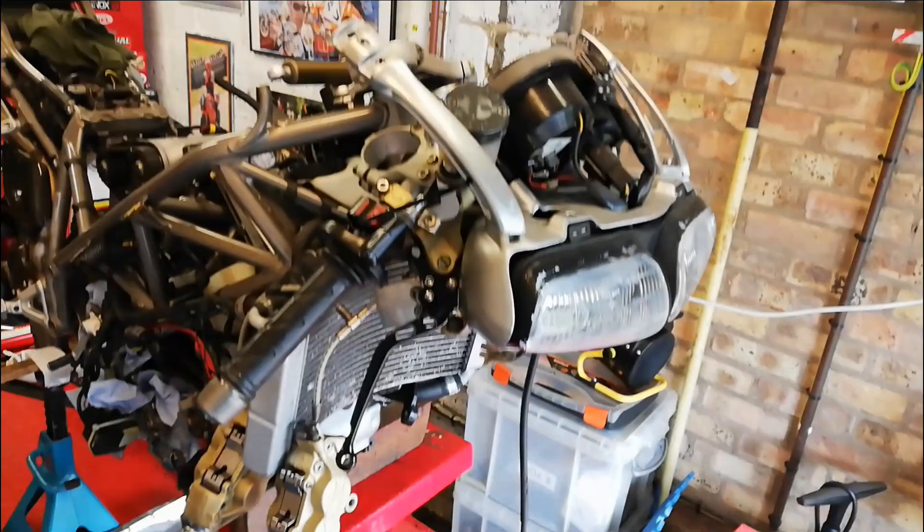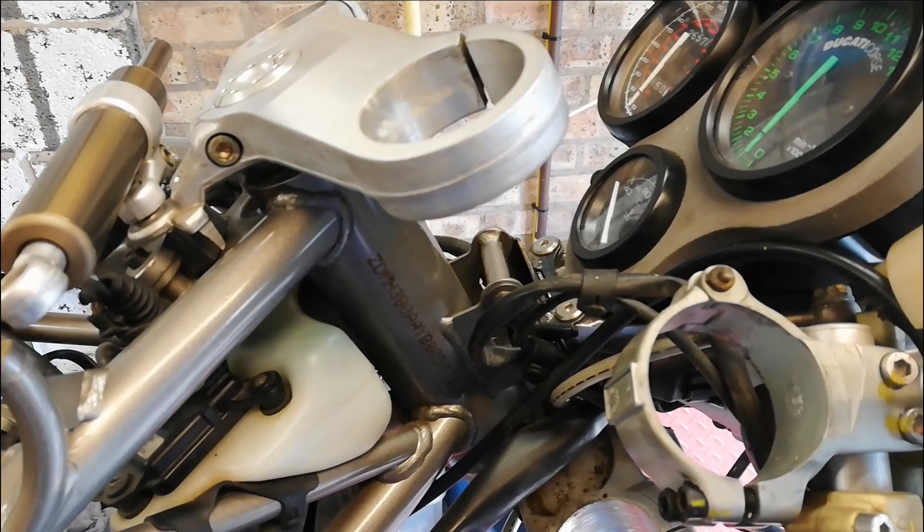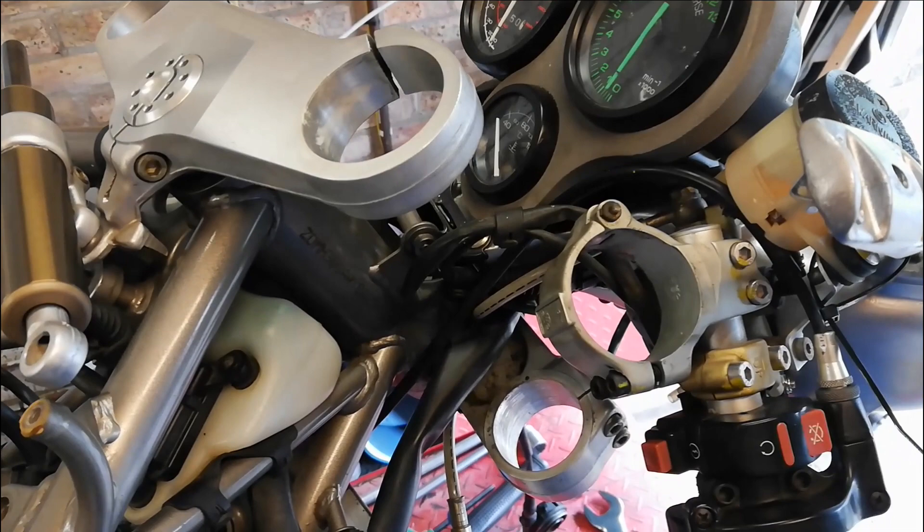We've now got Dave's patented hover bikes! Because I've got the forks on the bench - well, on the floor anyway - the eagle-eyed amongst you will notice I've put the proper paddock stand back in, which turns out is a little bit more stable. Next thing I'm going to do is take the yokes out, clean and grease the bearings. I've had a feel of them and they're nice and smooth so there's no need to change them, then we can get started on the forks properly.